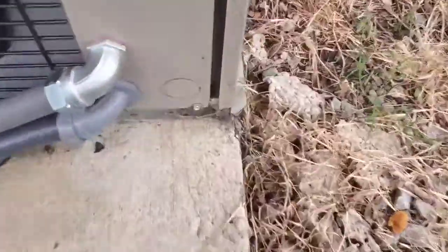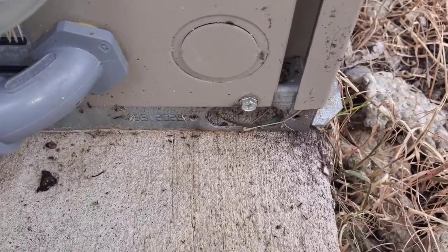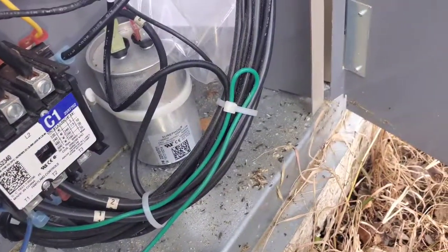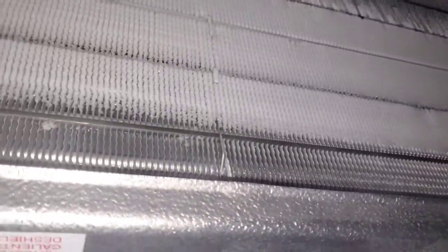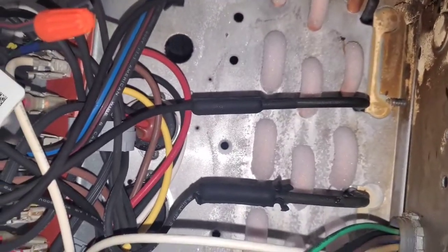When the fans come on, I'll test the defrost. I feel like I should have fans by now, and I don't. I don't have something wrong other than the defrost heater — the wiring is right. The defrost termination fan delay thermostat just must not be cold enough yet. But look in here — it's totally frosting the coil over.